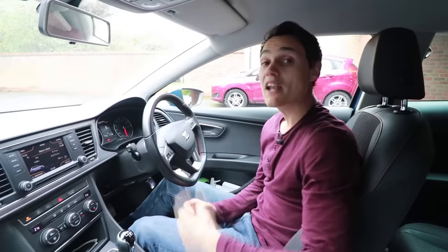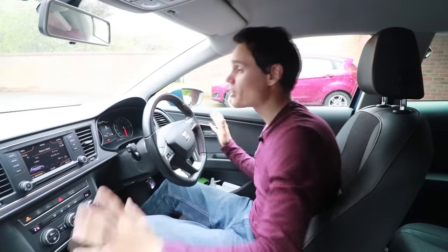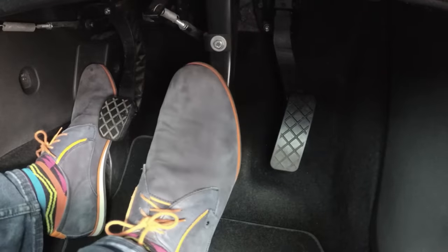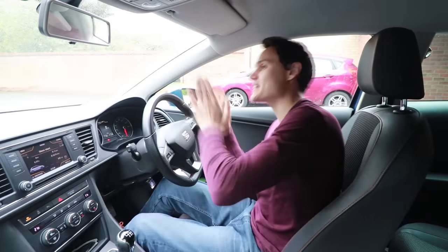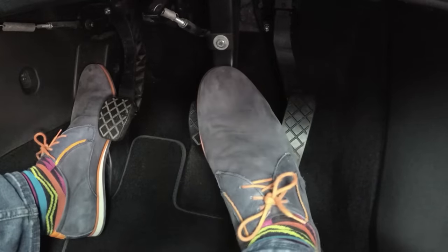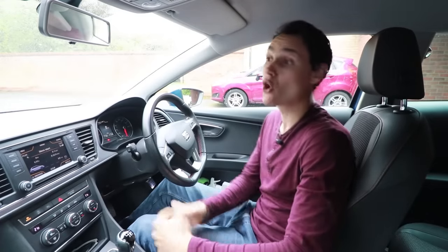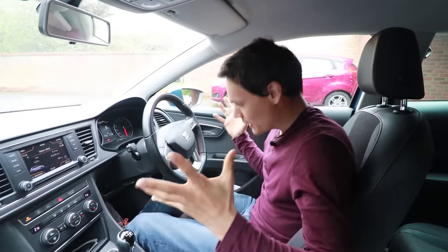A little bonus for the video: heel and toe. This is not for everyone — it's something you'd only do if you're really into driving. I'm not going to explain why you do it, just the foot position. A lot of people think it's literally heel and toe, and that's where they go wrong — I can't even twist my leg that much. It's just a name for the process. Essentially, the process is to be able to press the gas pedal a little bit whilst you're braking, and the important thing is to do it without braking harder. What normally happens when people try is they press the gas and also press the brake more, leading to very erratic braking.